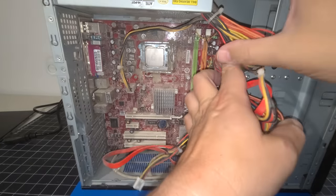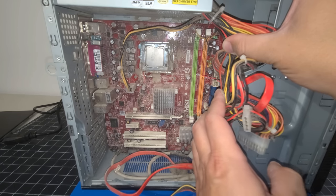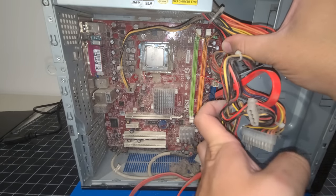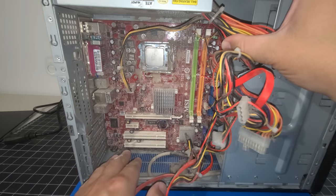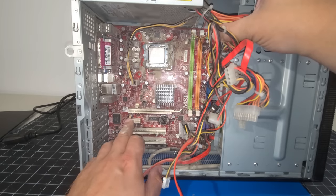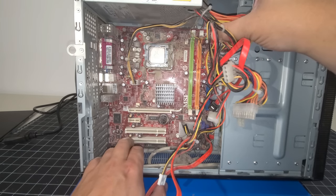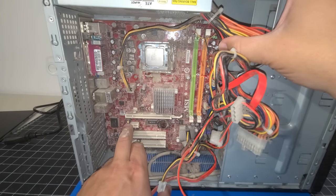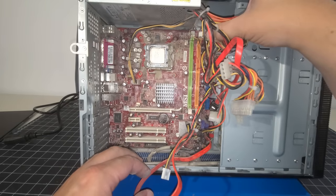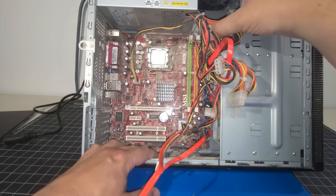It doesn't look like we have any memory installed, but those are DDR2 memory slots. We definitely want to get those scrubbed out before we attempt plugging things in. It looks like we have a mix of SATA and IDE — SATA ports down below and an IDE connector header right on the motherboard. And then we have our caps. I do have one very bad cap right here, and another bad cap — actually three of them for sure that are bad. I don't think I have these caps in stock. There's also a floppy connector down here, so I was curious to see if it would support that — and it does.